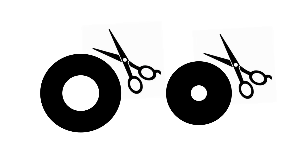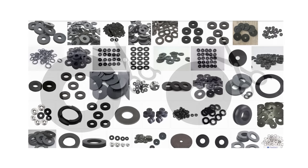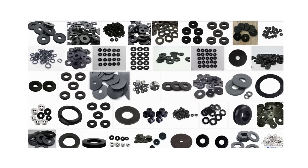And there's a much simpler solution, which is to make or buy your own disc that closes the size of the aperture. You could cut a hole in a round piece of black cardboard, or you could buy a black rubber washer and cut its outer edges down to size if necessary. Then you insert the cardboard or washer into the back of the projector lenses. There's enough space to do this in most lenses.